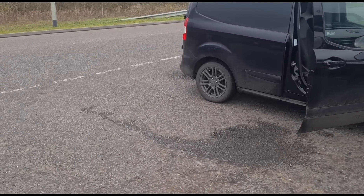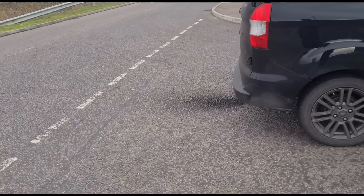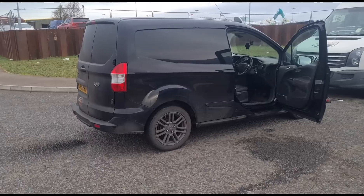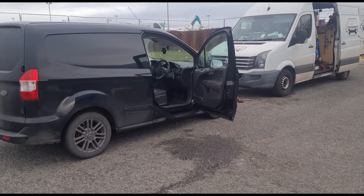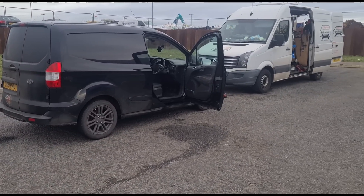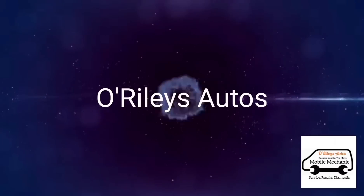You can see the patch it's leaving on the floor when you accelerate it. Unfortunately, any car that's got a particle matter sensor — Euro 6 — they are very, very sensitive. There is no leeway whatsoever. If this was an older one, you would have got away with it. But unfortunately for this vehicle, it needs a new DPF and particle matter sensor. See you in the next video.